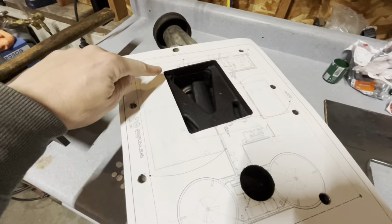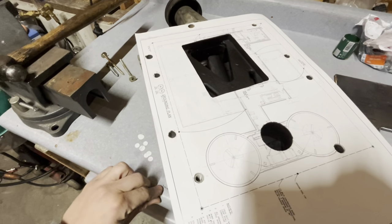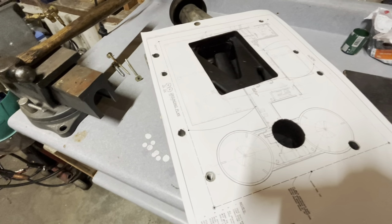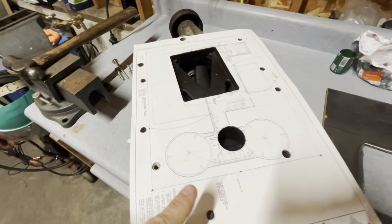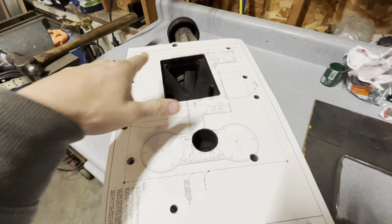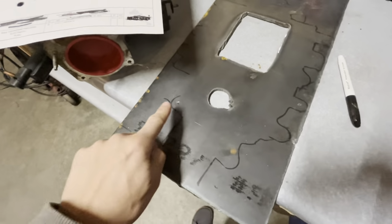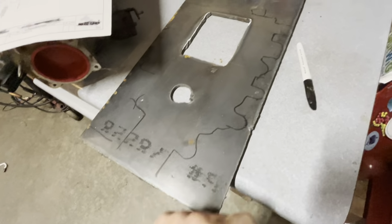And then I used the ball peen hammer again and tapped around this. Tapped around each hole, made these hanging chads here. And basically transferred the pattern onto this piece of paper. And what I'm doing is I started drilling pilot holes, but I figured before I get too far into that,